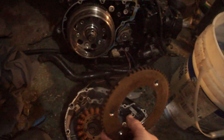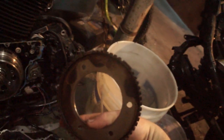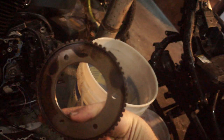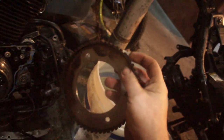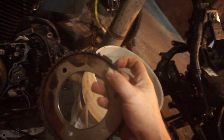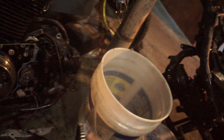Chrysler also uses effectively a 60 minus 2 tooth trigger, except instead of a large gap, there is a fat tooth. But it'd be easy to cut this fat tooth down to the size of one of the small ones and then have a bigger gap, and then just clock it right.